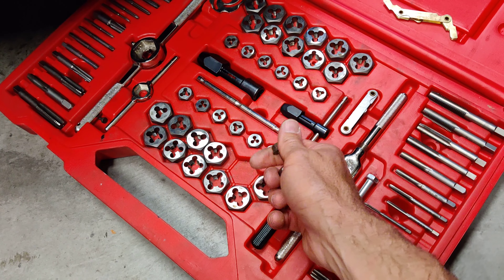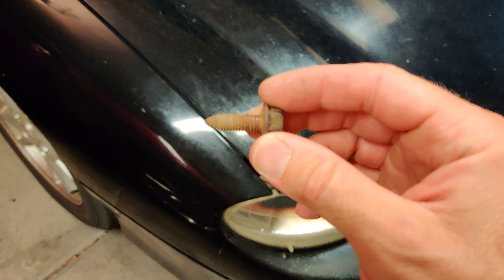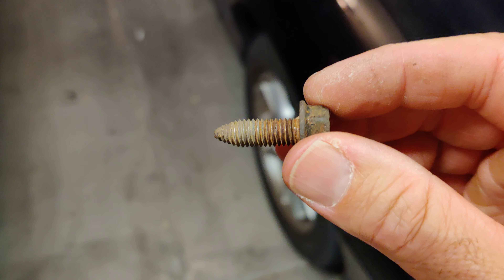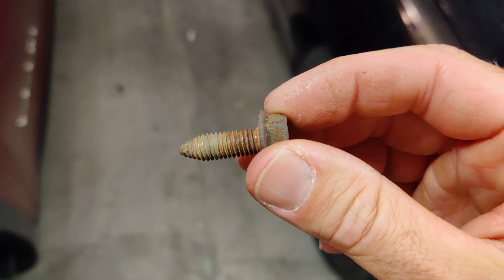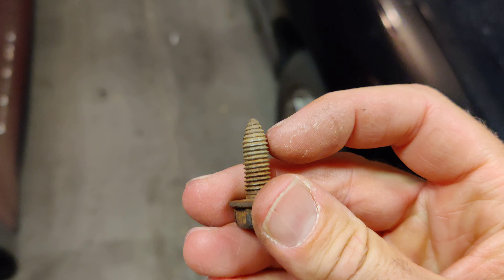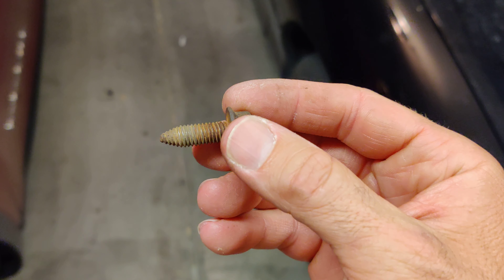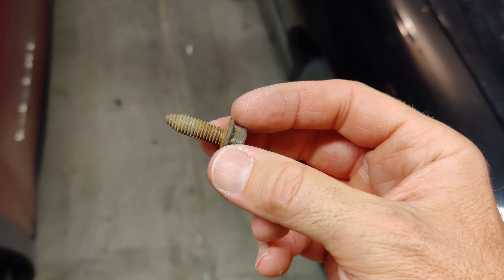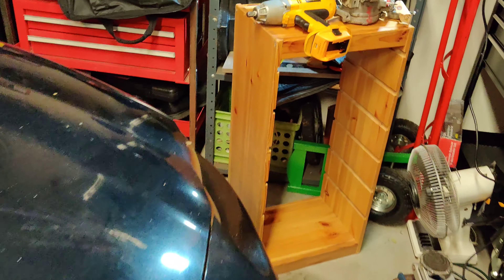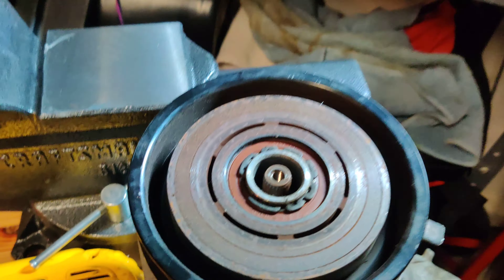This bolt came from a 1974 Nova — stock bolts used on body panels, probably on any Chevy or GM car of that vintage. Not only are they tapered, but they're threaded all the way down. I've kept a handful of these over the years because they're extremely useful — for putting them into brake drum holes and popping brake drums off cars, and things like that. On this AC compressor clutch disc, it fit right in and popped it right off the shaft.